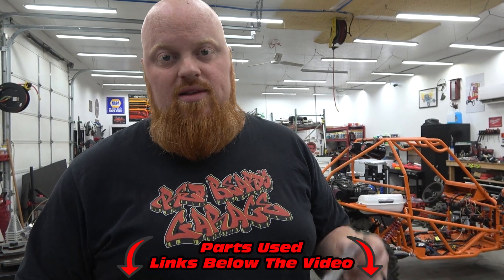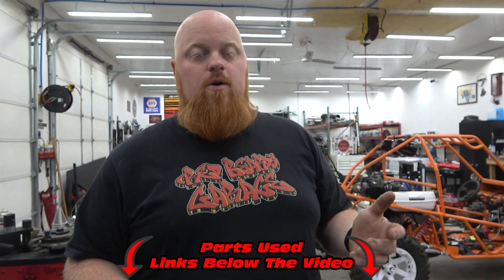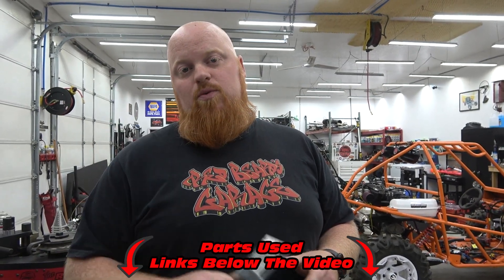So to recap, the tools you need are: a valve spring compressor, a stock valve spring, an adjustable push rod, a dial indicator, and calipers. We're going with 5.260 Go Power Sports push rods. They sell many different sizes and if you're building a lot of engines it's handy to have each size on the shelf — there are only about six or seven different ones. Check out the links in the video description for all these tools. Make sure to support Go Power Sports — they're supporting these videos. Stay tuned for the Ghost all-out methanol build coming very soon. Thank you guys for watching and God bless.